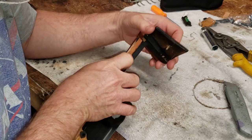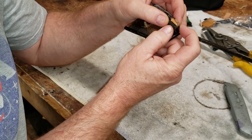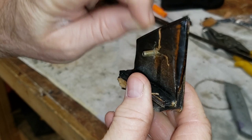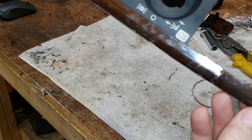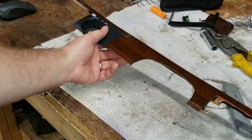There's the end piece. The inner veneer is delaminating on the end — that's pretty typical from what we've seen. We'll probably take this veneer off and JB Weld it back on. The inner part of this wood is broken where somebody tightened it down with a little extra torque and it tried to pull that threaded shaft out. The plastic just comes right off now that the staples are off. The top veneer is broken right there — once we start messing around with it, it'll probably just break right in two. We're going to have to get the heat gun out and start peeling stuff apart, and it's going to get worse before it gets better.